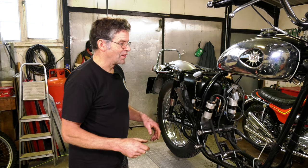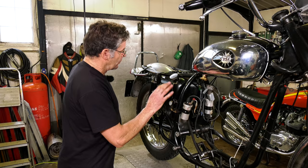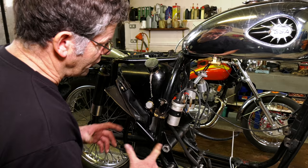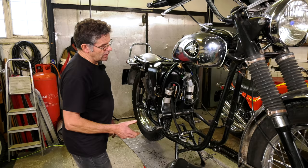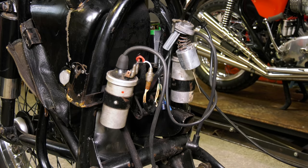I don't want to do it out - it's nice to have a bike that you can just ride and not worry about. Just an oily rag, WD-40, squirt over it and wipe it over. Oil tank - we're going to put new lines on here, new feed and return. It had been modified to an oil filter - I'll do away with that because oil changes are so cheap on these things, and the oil is the lifeblood of any engine. I believe in changing it more regularly rather than trying to make it last longer. A pair of coils here because it's coil ignition rather than the A10 which is a magneto. So we've got 12 volt electrics here, single carburetor, tiny little tank.